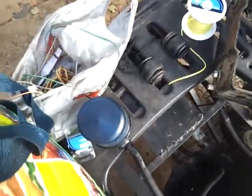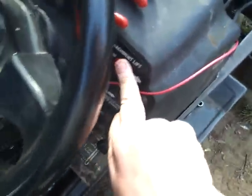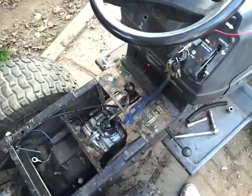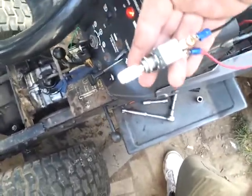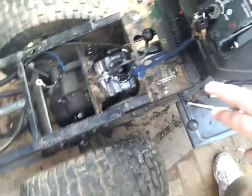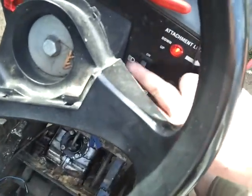My blinking light is no longer on its magnet underneath - it's on its own extension cord. On this side I also have a little power-on light. There was a knockout there, which I believe was for the electric raise and lower for the deck - attachment lift. There's also a new constant power switch here for my blinking light. My rear tail light is now linked in with my headlights and it's no longer a lighted switch.